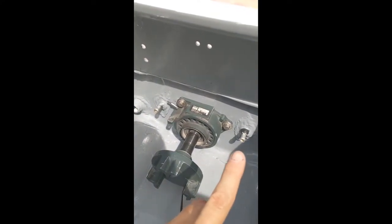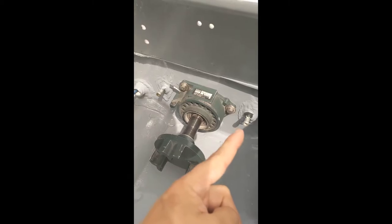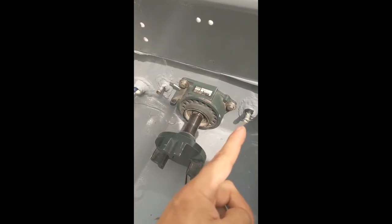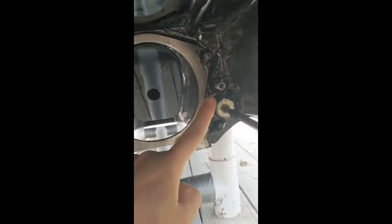So here's the other side of the pump area that I was talking about. So this is the stock bilge line that I've just converted into a second water line. It's just painfully easy. Just remove it and just feed this into your intake manifold. Or excuse me, not your intake, your exhaust manifold. And that's pretty much it. And that'll give you a second cooling line. And just to kind of recap, those hook into here and here, which go here and here.